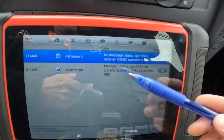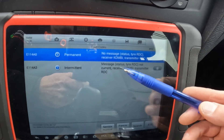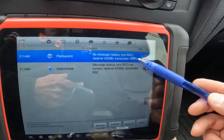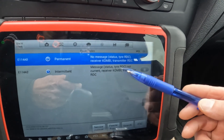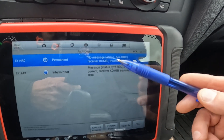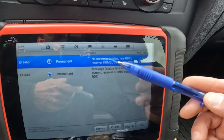Normally when you're diagnosing problems like this, the receiver is not the problem — the transmitter usually is. In this case the transmitter is our tire pressure monitor control module, and the instrument cluster is not getting any signal from it. This is a bus signal that comes up from the KCAN and gets sent to the instrument cluster.